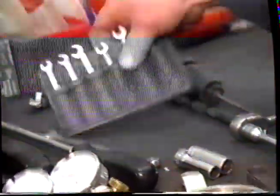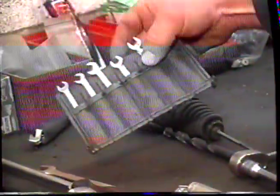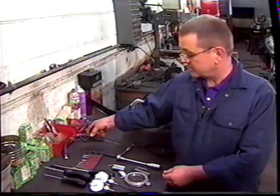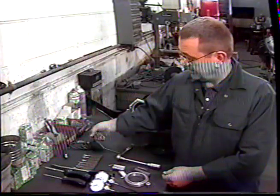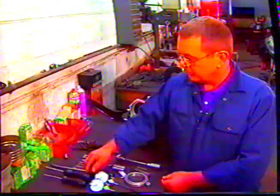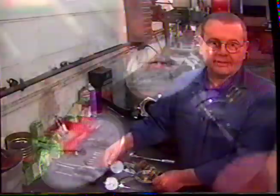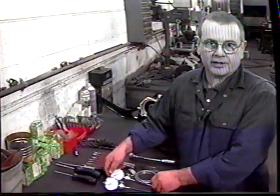We're going to need some small wrenches to take the nuts out of the distributor, a test lamp to assist us in timing the car, a gauge for setting the float heights, several different screwdrivers for removing the screws on the carburetors, and 2 gauges to do our final carburetor adjustment. And now we'll go and take the plugs out of the car.